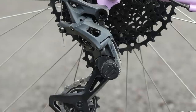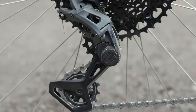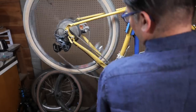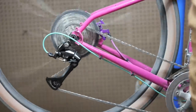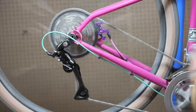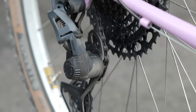Let's talk about the rear derailleur. Overall it looks a bit more refined. The clutch actuation is done with a knob rather than a switch. The cages between the 1x and 2x are supposedly interchangeable. I did try the 1x rear derailleur on the Sklar with my wide-range double and it didn't work — the very inexpensive Asera had no problems, but the 1x wouldn't work. Maybe the 2x-specific cage would work; we'll have to see. But to be clear, the 1x rear derailleur seems to work best in a 1x drivetrain — no surprise.